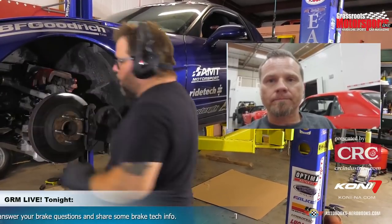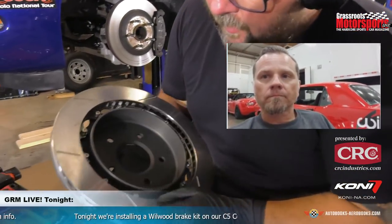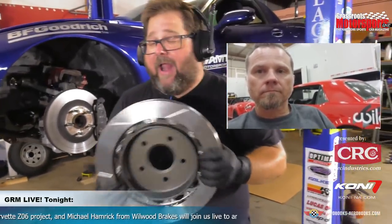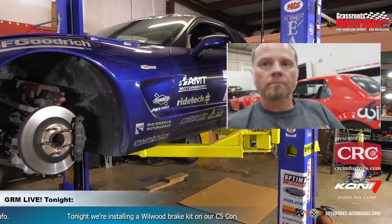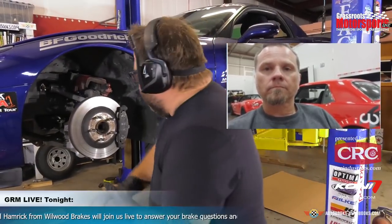Okay, and let me actually show them the inside of the rotor hats. When we bolted together these rotors, you might not be able to see on camera, but all of the bolts affixing the hub to the rotor are pre-drilled for a .032 safety wire. Now, I did not have any .032 safety wire, and it's not arriving until Friday, according to Amazon.com. So I have not yet safety wired these, but I will absolutely be getting around to doing that as soon as my friendly UPS guy shows up with the order. And just before you even ask, I'm not just going to take a single piece of safety wire and run it through each bolt and then wrap it around along the last one. I'm going to do it right. At least I'm going to start doing it right. And then we'll see how many pain pills I have left at that point.